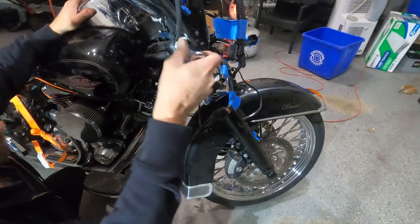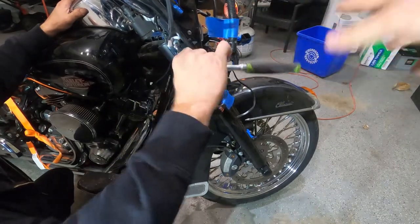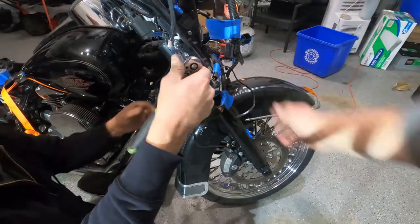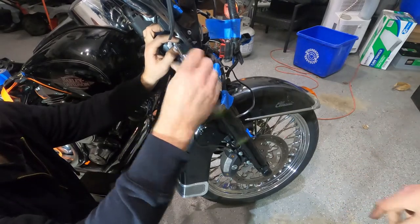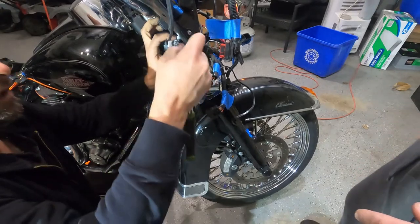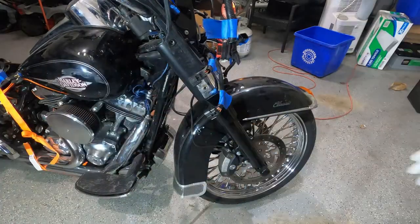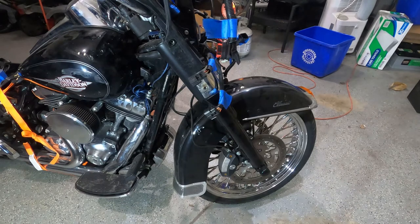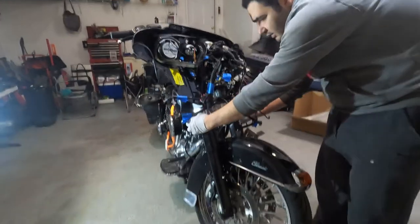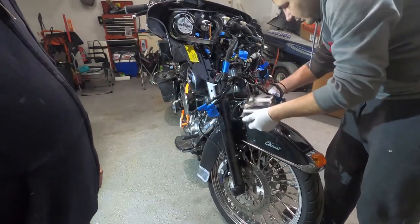Now we mark a lot of harnesses here, so we're gonna start to take some bolts and screws out and see if there's any other harnesses still connected behind that front fairing here. So we're gonna take both sides, signal lights off by the T27 and the T30. It's gonna be the same on the other side, so you're gonna put it down. So now we don't pull the light out, we just gonna pull that front fairing out. Okay.